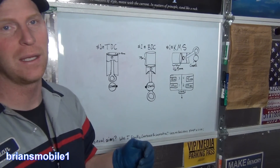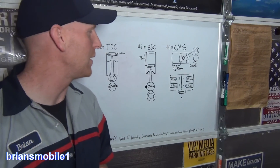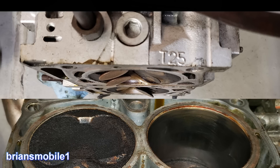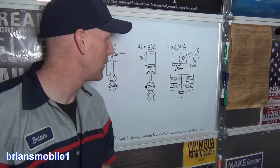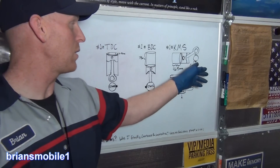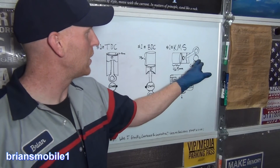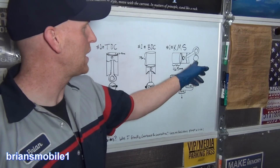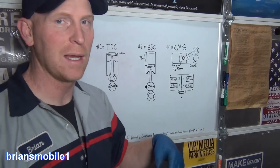Once this timing mark is in this position, the world is your oyster for cam movement, as long as it doesn't move. However, it's not the other way around — you can't get away with moving the crank or you can hit valves. So as far as the keyway goes, you can tell where you're at. When you're putting the timing belt on, when the Woodruff key in the end of the crank that the harmonic balancer lines up with is pointing down — let your guard down. You can rotate it any direction you want; it's not going to hurt anything because all the pistons are as far in as they can be.